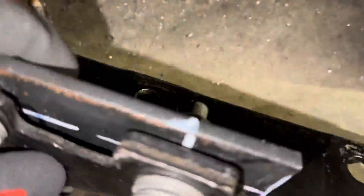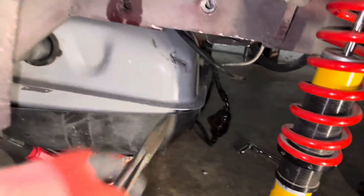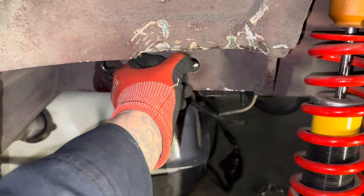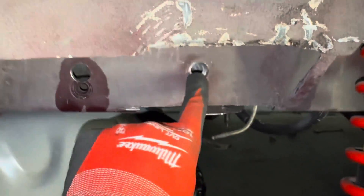This is going to go where these typically go when you have your IRS — you'll see how it goes. This part here will go in here and then you bolt it down. Everybody says you can use the quad shock mounting bolt location, and I had said that as well, but one thing I noticed is they never thread correctly — it's the same thread pitch as the drive shaft bolt. If you have a drive shaft bolt it will thread into there, but then it gets hard right away.